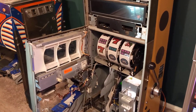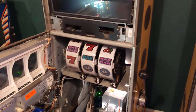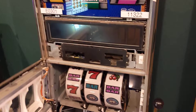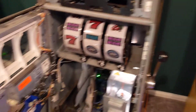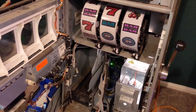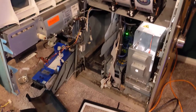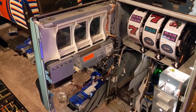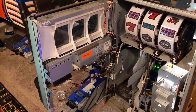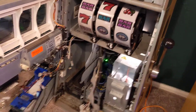This one I started working on — this is the three reel five line, and boy, this one is in bad shape. The cabinet is filthy, and I cannot get the bottom door to close. Plus there's some other issues: this jumper switch here is not making contact, so wires are probably loose behind there. There was no CPU box in there, so I had to steal a CPU box from another machine to put it in there. It also does not have the BV harness, so I've got to put the bill validator stuff in there. I do have a ticket printer, so that's good. I cannot get the door to close, and obviously that's not going to work — something's not lining up. I'll probably take some parts out of another machine, probably replace this door. Process of elimination, I figured out something's not making connection here and I can't really see it to figure out what it is.